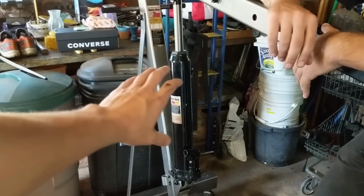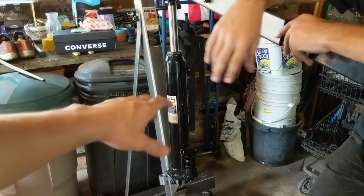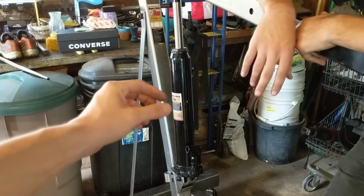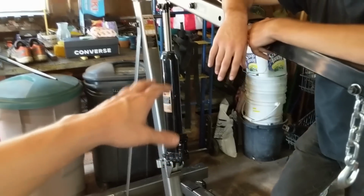My whole thing is, there's rubber seals all throughout your brake system, like the master cylinder and the pistons, and a clutch system uses brake fluid too. Those have rubber seals. I don't think there's anything fundamentally different about this jack, just a rubber seal being pressed. Other than maybe if passage sizes are too small and there's a viscosity difference, it might blow out a seal or something. But basically, I think it's a bunch of forum warriors who don't actually know, and they're just going to give their opinions.